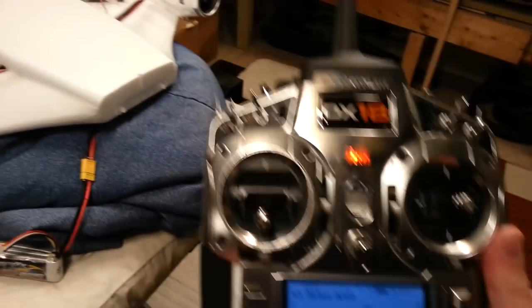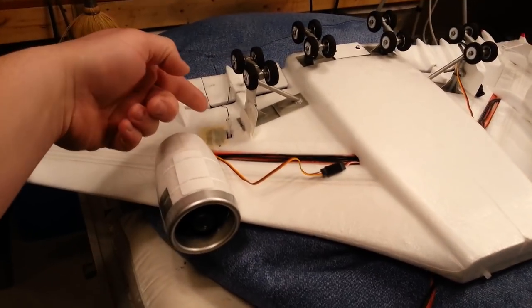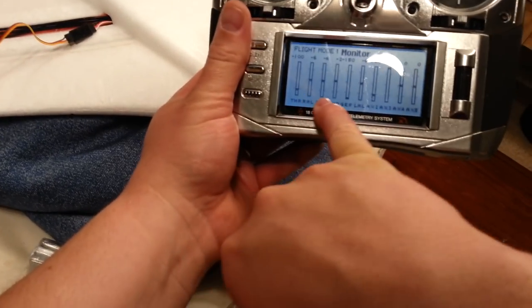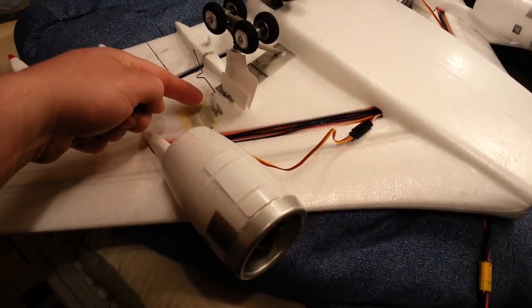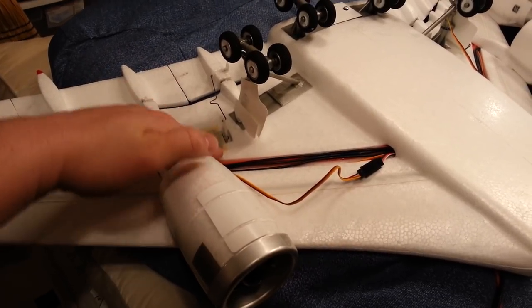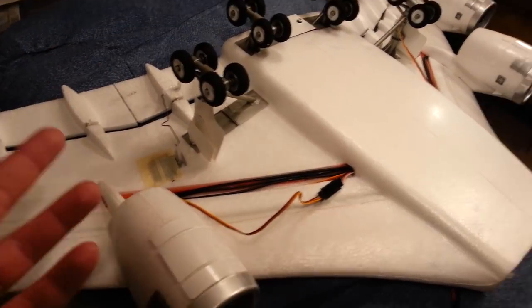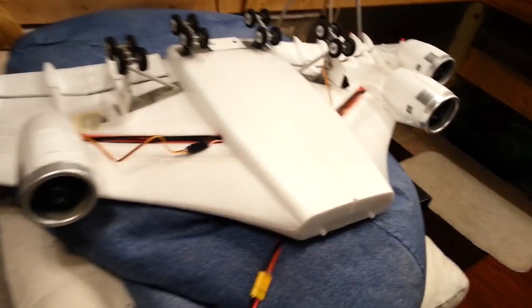One other thing to be really careful about - when I plugged this in today to work on it, my radio didn't really connect and so the servo went to center. Where's our servo on the gear? It's all the way to one side. What happens if this thing goes to center? It's going to yank the flaps down to the extent that you may actually break this out of the pocket, because this can only go so far and that thing will lift out of the pocket. So just be as careful as you can on that. A couple of landmines you'll want to avoid stepping on.